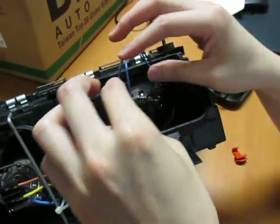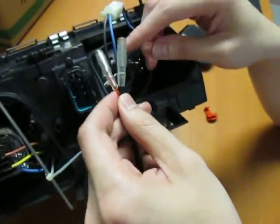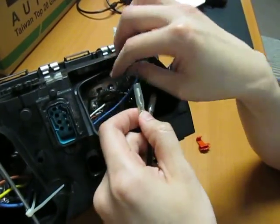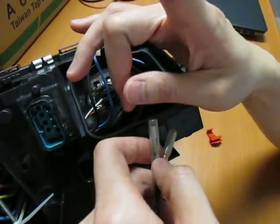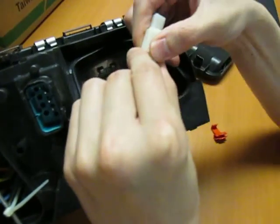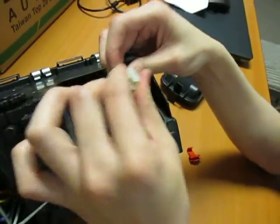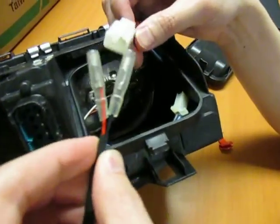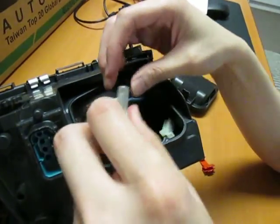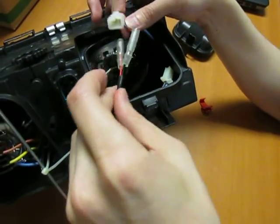Now the idea is to connect this, which is powering the Angel Eye, directly to here. You can either solder them together, and you have to understand the red is the positive, so it has to connect to the blue, and then black is the negative, connects to the black. That's the first way to do it. The second way doesn't require cutting, so you're not cutting anything on this side. You simply connect this particular connector, then leave this thing alone. However, you try to connect this with this. Obviously they don't have the same type of connector, and why did I say this is only optional? There's a reason, because it's only giving you so much access of wire, but regardless, either way will work. Now, how do you connect between the two?